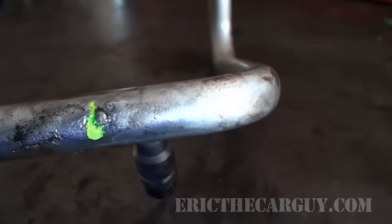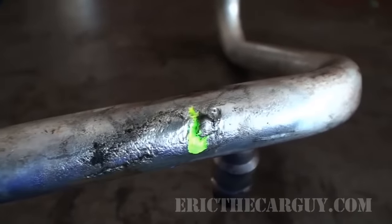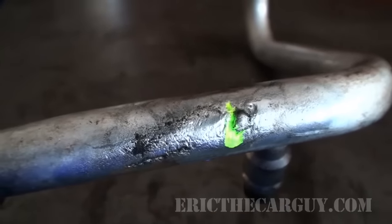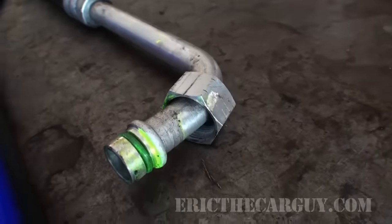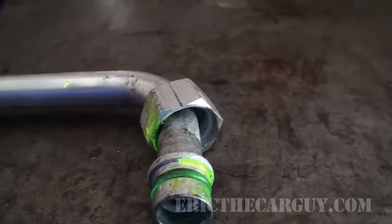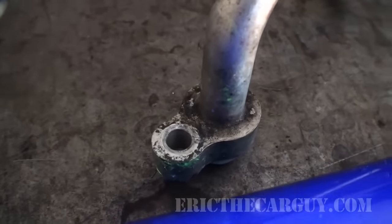While editing the video, I realized I never showed you the dye in action. If you just take an old 1970s black light — a UV light — and put it on this dye, it tells you exactly where the leaks are. It's really easy to find them. Any place this dye goes, it's going to show up very clearly. If you look down inside the system, you can see it pretty much permeates everything and goes throughout. UV dye is a great way to find AC leaks.